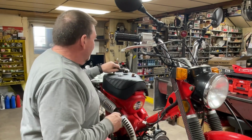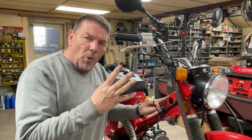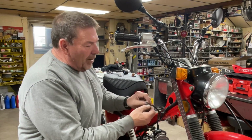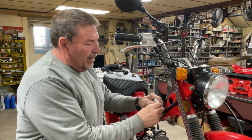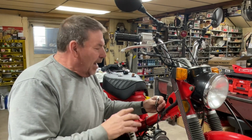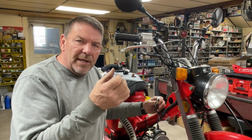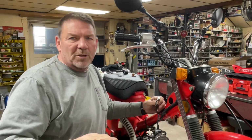So to begin with, all of these 12 volt harnesses basically have 4 wires for the key switch, and it is a simple design. There is a green wire and a black and white wire. Those are ground, and the black and white is the kill wire that goes to the CDI. In the off position on the key switch, the green and the black and white have continuity, and they're connected. And so the CDI is being grounded, and that kills the spark.